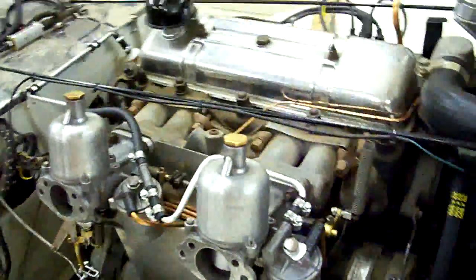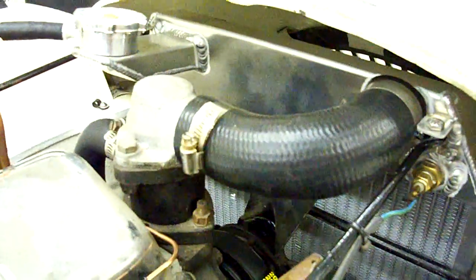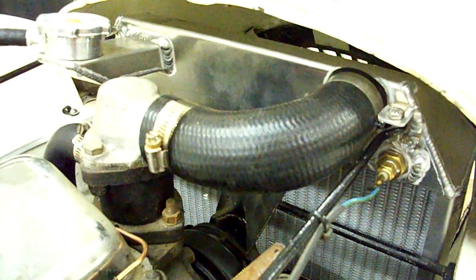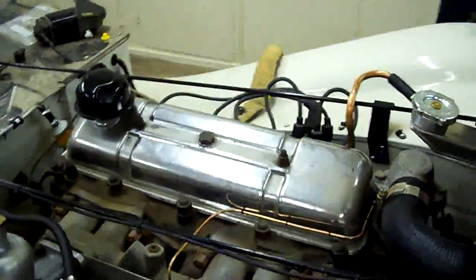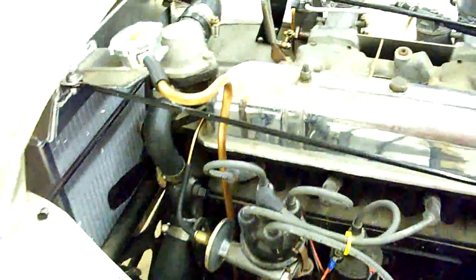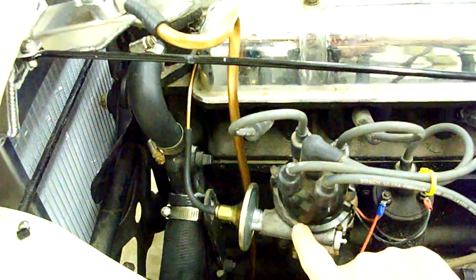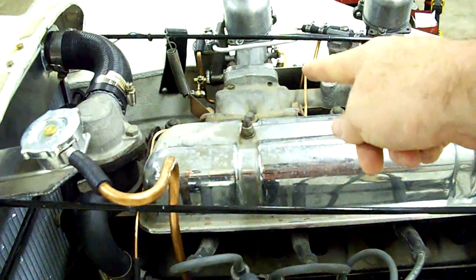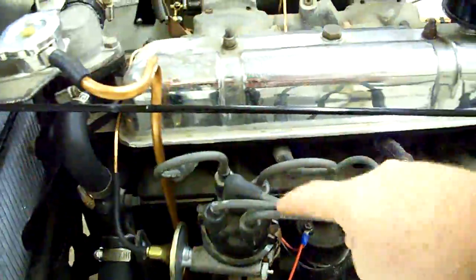For the cooling system, I upgraded to a beautiful aluminum radiator. The original had been patched on patched on patched, and the amount of labor it would have taken to rectify other people's work would have been more than the price of a new radiator. I reworked the distributor and put in a new vacuum advance — the old one was bad and wasn't even connected. The port on the carburetor was wide open, which is why I had to make that little nipple fitting. I also switched over to electronic ignition.